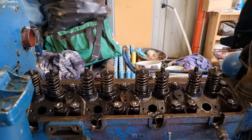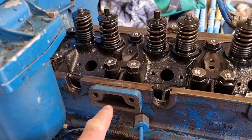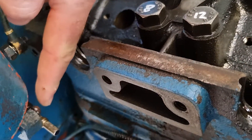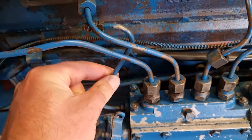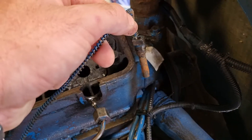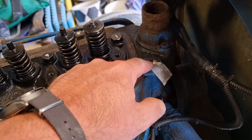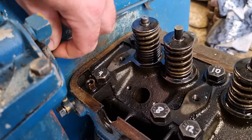If you go around the other side it's a little bit more complex. First up we had the diesel fuel filter connected — this pipe here, that one there to the other fuel filter, then from there on this one down. We also had our temperature gauge — took that out of there, blocked that hole up with a bit of tape so nothing sneaks in. We also had our bleed off there that goes through to the tank, took that off.